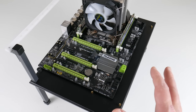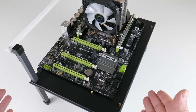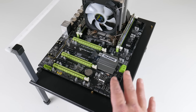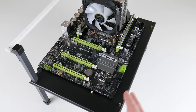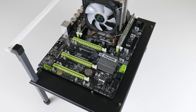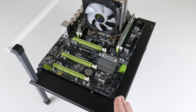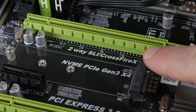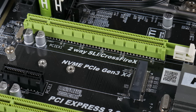This is the setup we're going to use today. It's an LGA 2011 motherboard that comes out brand new from AliExpress. We've been using this motherboard quite a lot in recent videos and I did a full review, so I'll put a card up on screen. The highlights are a ton of PCI Express slots, M.2, Quad Channel Memory, and a ton of really interesting processors for Socket 2011. Underneath the first PCI Express slot it mentions 2-way SLI and Crossfire X, but I'm a little skeptical — we will find out soon if this is actually working.